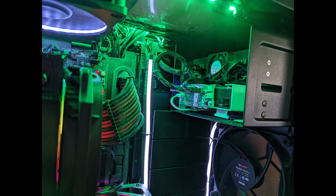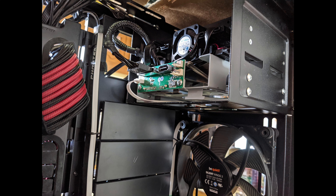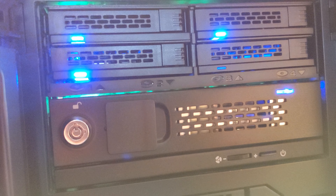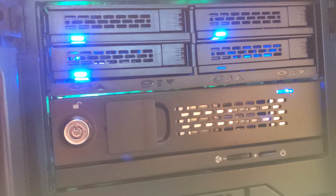I hooked up all five SATA data cables, having marked them to keep things neat and tidy. With everything plugged in but the panels not yet attached, you can see the cardboard template showing through the clear plastic at the top. With the side panels and RGB lights on, it looks really good. The front panel open reveals the four-bay SSD at the top and the hard drive bay right under it. When drives are in use the lights blink; a solid light indicates an active drive.